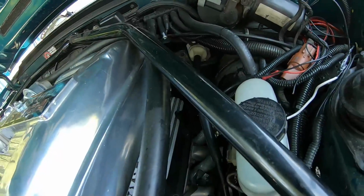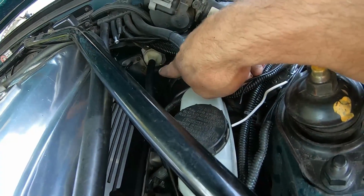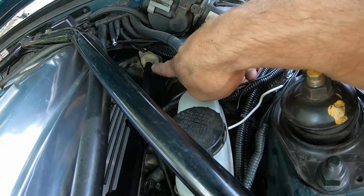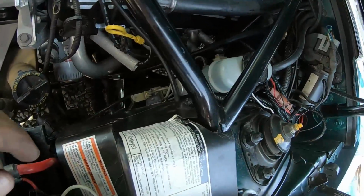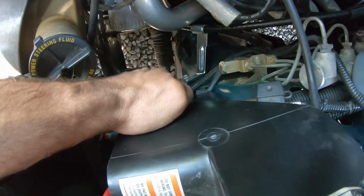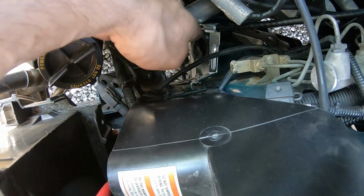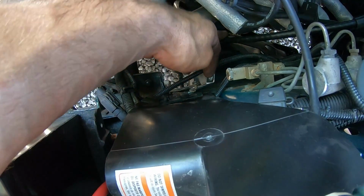It's hard to see because of this stupid strut tower brace, but we got the mount in for the UPR. You have to actually pull the rubber mounting thing off of the new cable so it can slide through the actual adjuster. The nice thing about Fox bodies is they came AOD or 5-speed because the bracket already had its hole, his little set hole here, and this is like a 10mm sheet screw. So I'm gonna get this screwed in. I'm gonna bend this bracket back a little bit to keep this away from the header because it'll burn.